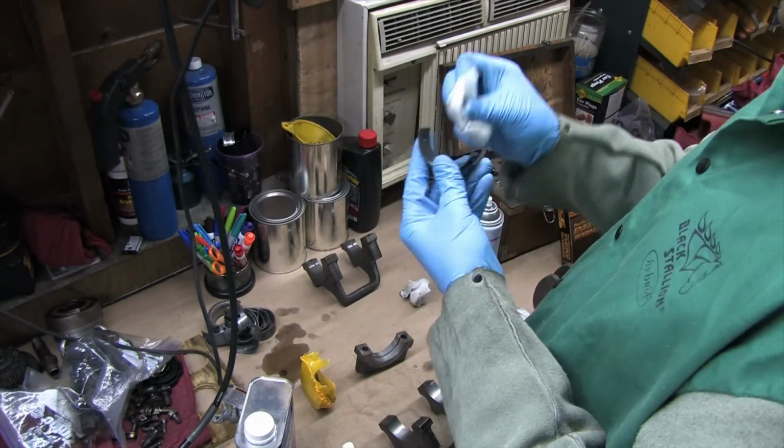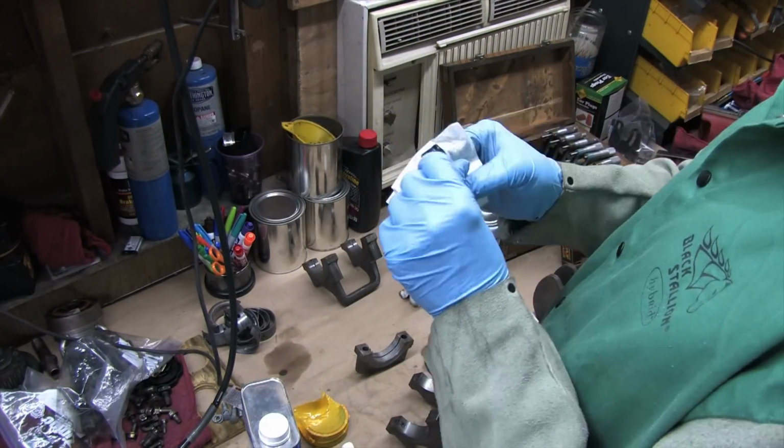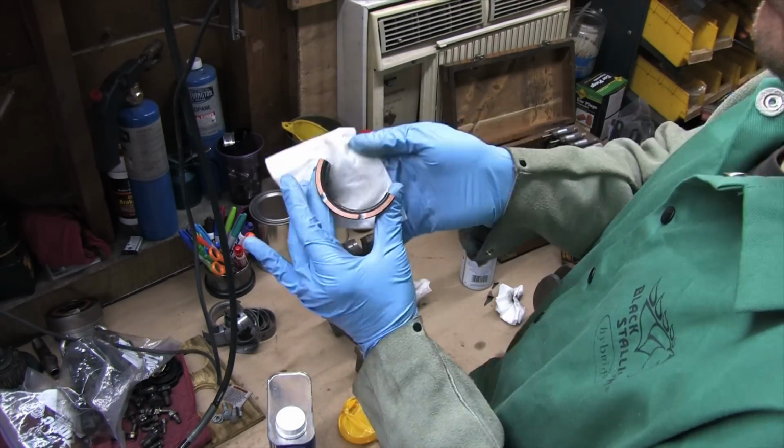It won't happen every time you fail to do this step, but in my opinion, you should always do this whenever you're installing a crank. You want all of the bearings bone dry and tightly seated against the surface of the block so that when you install the crank and torque it down, they'll etch themselves tightly in place on the first heat cycle.